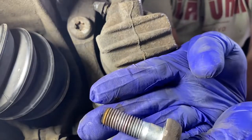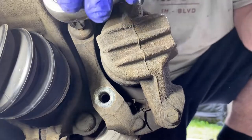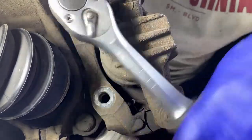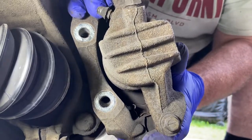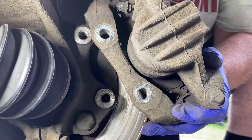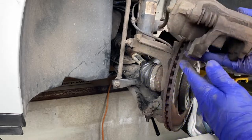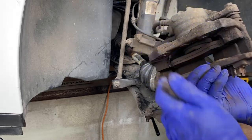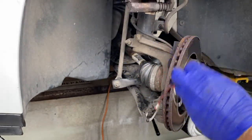That's what you can expect to see — just that bolt with the T55 head, quite a large bolt. I'm doing all this from the outside of the car, which is what you'd likely be doing if you're beside the road or on your driveway. Now the whole assembly will come away with the pads and the caliper attached — this is why we opened up the piston earlier to allow that travel. The whole thing lifts away as one piece: the brake caliper, the pads still contained within, and the piston we compressed back. We can now tie it up out of the way — I've got a little bungee cord.